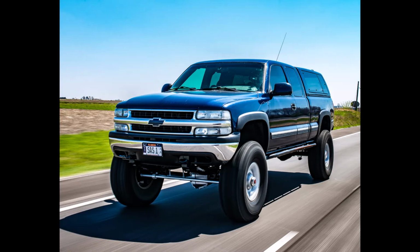So these 40s were awful, but I didn't know. They performed great off-road, but one of them was out of round. Could never get it to balance. Tried Centramatics, tried balancing media, tried a ton of balancing media. Nothing. It always vibrated like crazy, like a slipped belt or something. Yeah, a broken belt or something. What were they? They were MTRs also, the old style. Oh, I do remember those. It was surprising going from 37s to 40s, how much traction they had. But I only had them like a year or two.